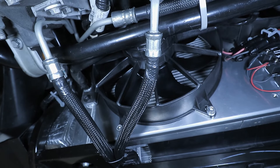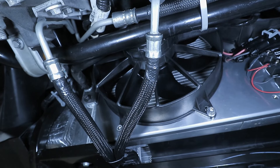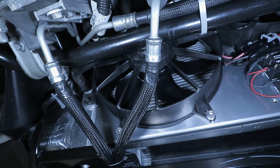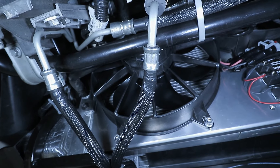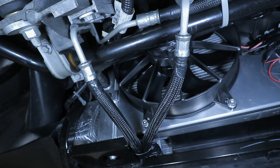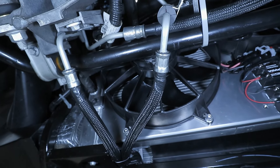After doing some work in the car, I finally got this ProSpeed fan installed. I want to go over some of the issues I had with the install on my particular car. At first, I could not get it to fit in. I had to take it completely apart and install the aluminum housing or chassis first onto the radiator, then install each fan individually so I could fit it past the sway bar.